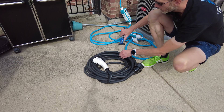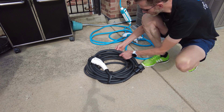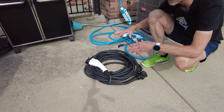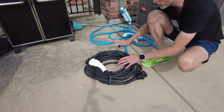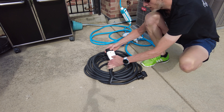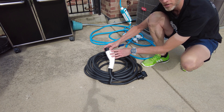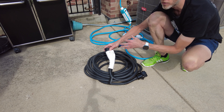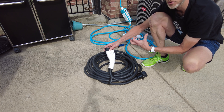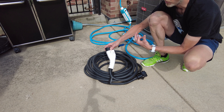Let's have a more detailed look at the cable. The cord itself is very thick — it is 21.9 millimeters. It has all of this great UL certification stuff written on the side of it, so we can have a lot of confidence in the cord and cable. The gun itself has a nice dust and water cap to keep it clean. The specifications on here note that it is only good for 40 amps. I have used this with my 48 amp charger without any issues, but I haven't done it for an extended period of time and I probably wouldn't, given my general hesitancy to push beyond the ratings for these kinds of things — but I haven't noticed any problems, so use it at your own risk.